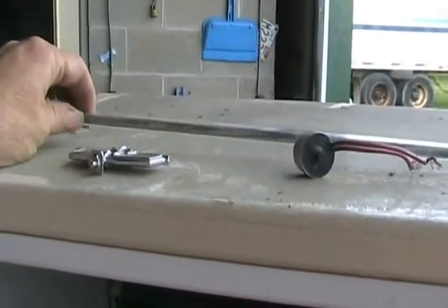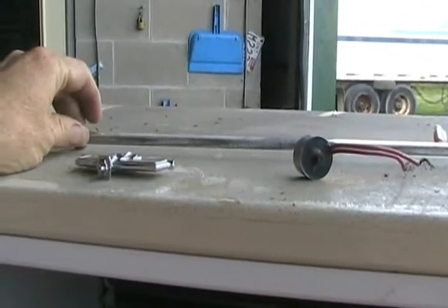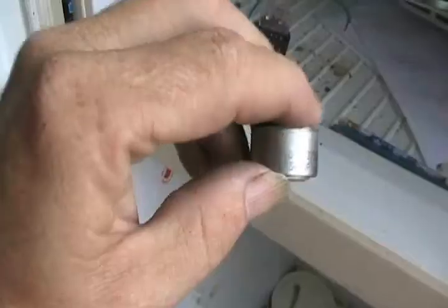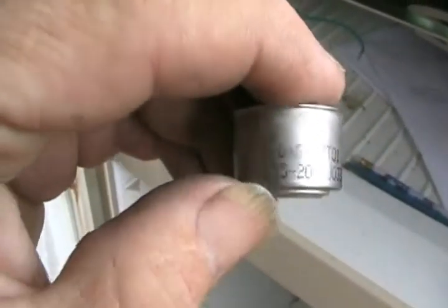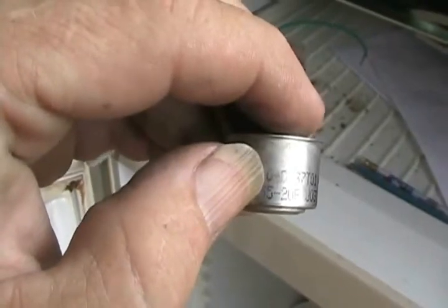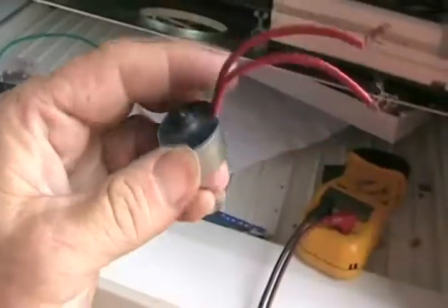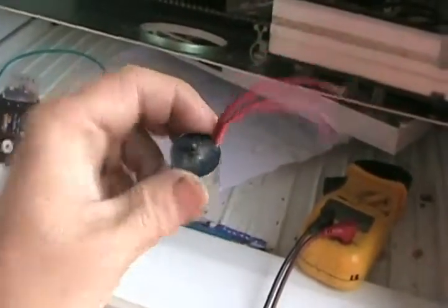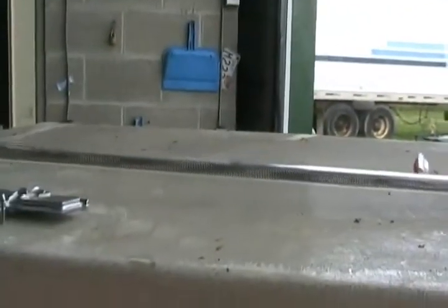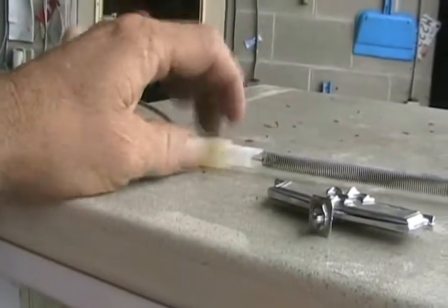If you have the heater tube that looks like the black one from a stove element, those ones most rarely burn out, hardly ever. When replacing these defrost termination thermostats, it's kind of important to try to get the new one close to the larger number. The smaller number doesn't really matter. You can't tell when these are burned out by looking at them. Only the meter can tell you. Sometimes you can tell when the glass tube ones are burned out. You'll see actually the little coil inside snapped, or even burned off on the ends, and lots of different colors in there.